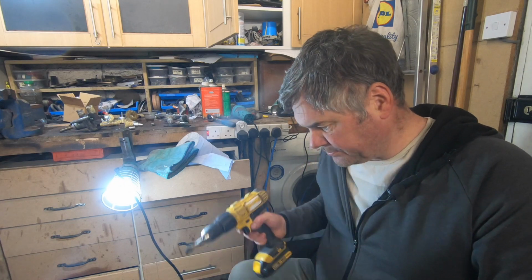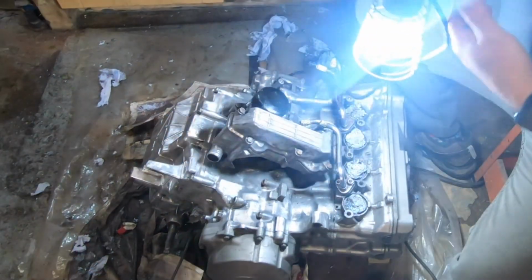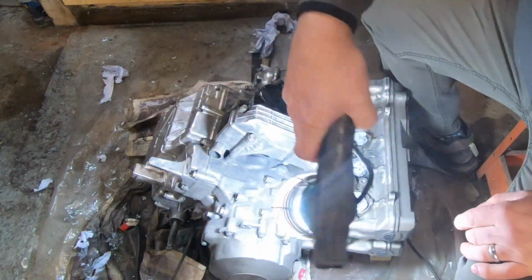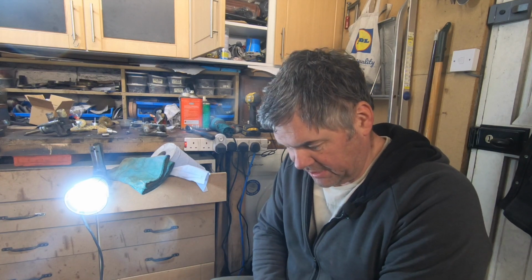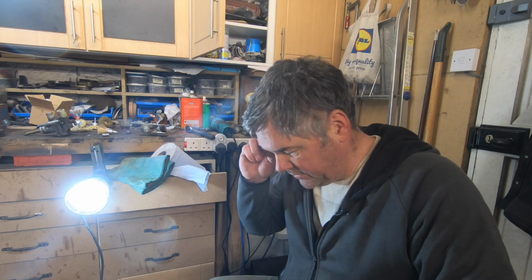it's quite good. The other thing is that it's hard to see where you've gone. It sounds daft. So you've got to get a light. Some of that looks mucky to me, but when I go over it with the light at different angles, it's all covered. So you keep the light on and keep working round. Otherwise I've found that I was going over the same bit a couple of times, so just keep checking it, going round, getting as much paint off as you can.